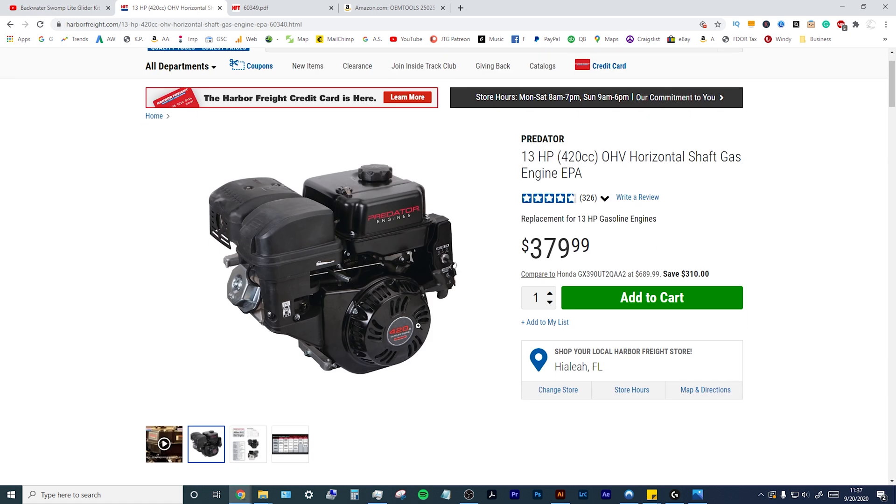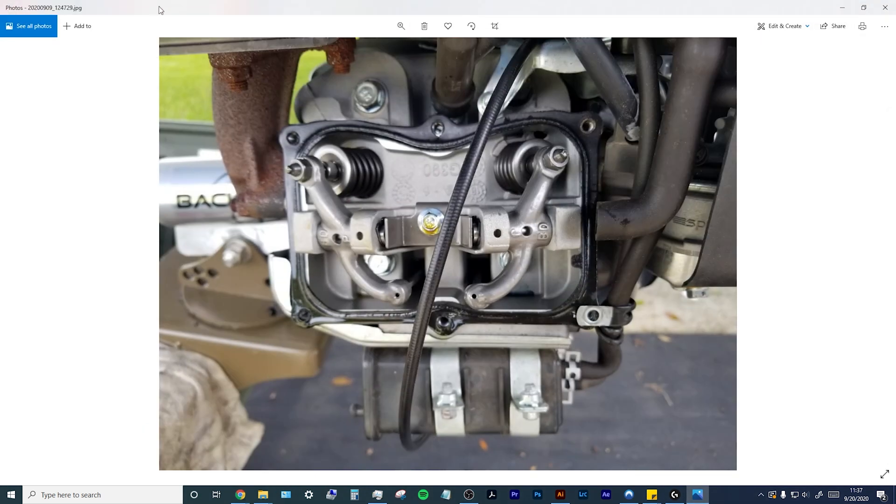The first thing you'll need to do — you can do it without this step, but it does help — is to remove your recoil cover. It's three bolts or screws: one here, one here, one on the bottom. Take those three off, this comes off, and you'll see a gray little wheel there. You can turn that so you can get the valves to sit where you need them to sit. When you open it up, it'll look like this, and it looks completely different than what everybody else shows online — that's why I'm making this video.